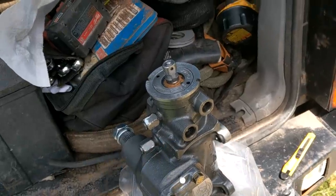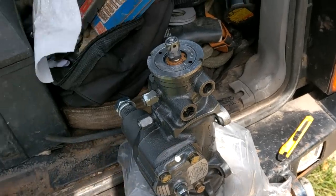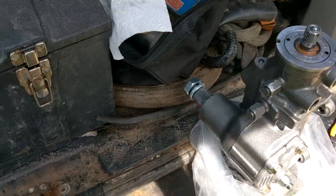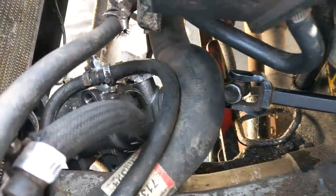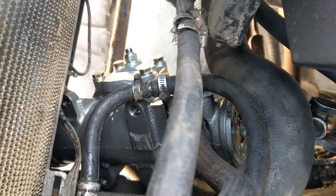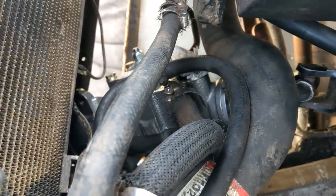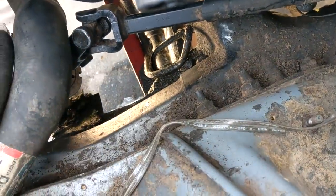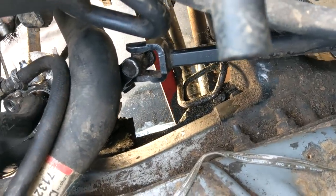Such a kick in the teeth because the old box that I sent had ports, so I did a better job than they did. I'll take some paper towel and crumple it in there so we don't get any dirt in the ports, and we'll jam this thing in. Now the fun part — you can go underneath and try to wedge the box so it kind of sits in place. The sway bar is helping to hold it up, and the fun part is trying to align this steering shaft since this thing isn't collapsible. It's a real pain to get it to line up because the box has to be at the right angle to slide it — it's an all-around bitch. Lube, hammer, lots of patience.